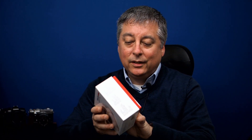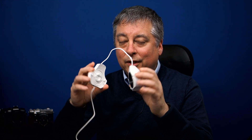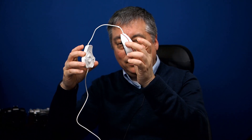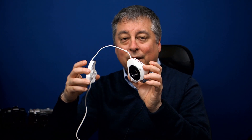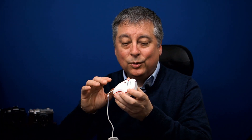Let's look at the device itself. It comes in a small box with a serial number — you'll need to download the software from their website and enter the serial number to activate it, so save the box or take a picture of it. The device is very small and compact; it breaks into two pieces. You hang one side off the back of the monitor to counterweight it, while the optical sensor on the front picks up colors and light from the display. On the back is an ambient light sensor to measure light in the room and help you set the appropriate monitor brightness.